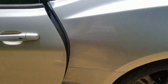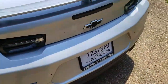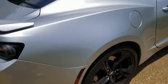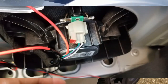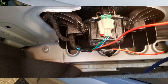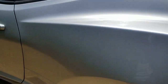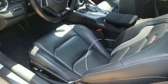You can tap into the speaker wires in here. Basically it's two wires — the green wire is ground on both the left and right sides, and whatever color the other wire is is positive. Everything else is straightforward; the battery is in the trunk, so nothing out of the ordinary for hooking that up.